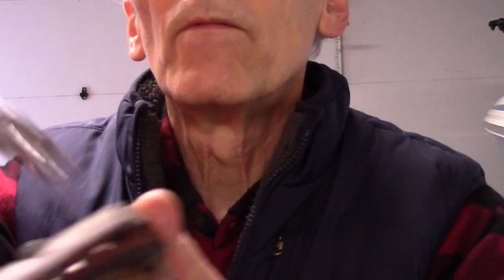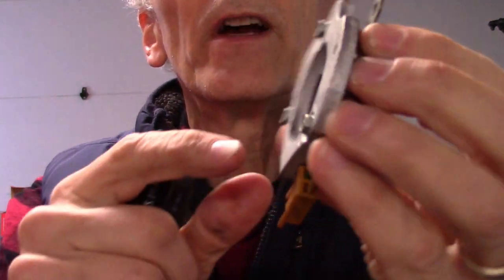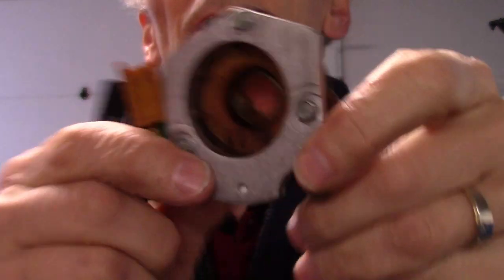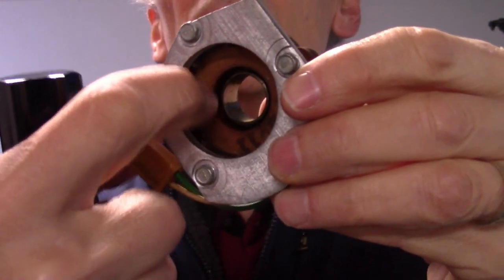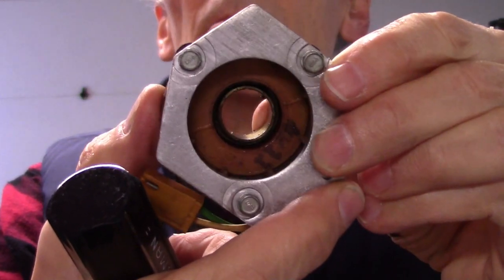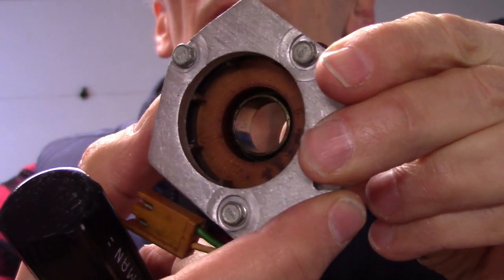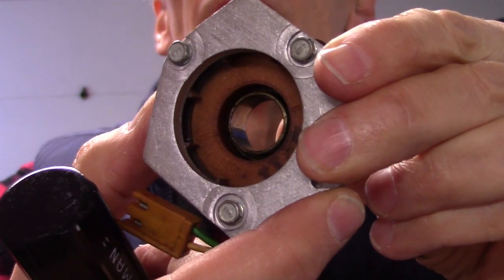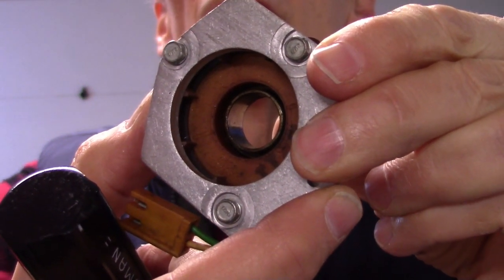The pickup itself is a little bit tricky. So this is what the pickup looks like. You can see inside that there are, for this engine, eight points, and those line up with the points on the shaft — with the pole piece. When the pole piece rotates past those points, that's when you get a magnetic impulse that triggers a spark.